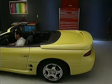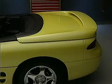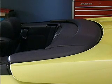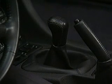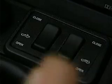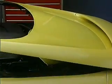Closing the hardtop is basically the reverse procedure. The hardtop is in the fully open position, the tonneau is closed, and the vehicle is idling in park for an automatic or neutral for a manual, with the parking brake applied. By pressing the hardtop switch to the close position, the ECU starts the closing sequence. The tonneau position sensor tells the ECU when the tonneau is open far enough to begin closing the hardtop.